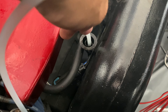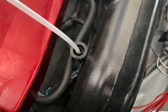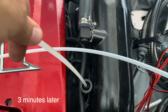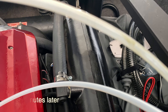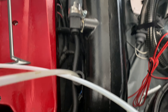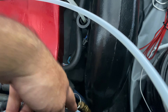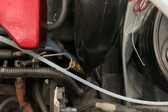Nothing yet. I know this is probably going to be a slow process. That absolutely didn't work — I was sitting there pumping forever and you can see it's dry all the way through the line. So going through the dipstick is not going to work on this Malibu. Now we're going to go to Plan B and try to do it through the drain port instead. I'm going to take the top off it and see if we have any better luck.